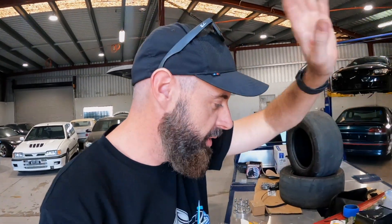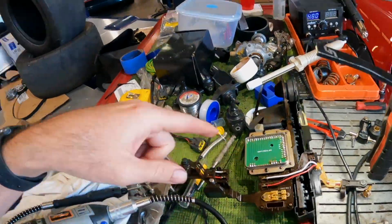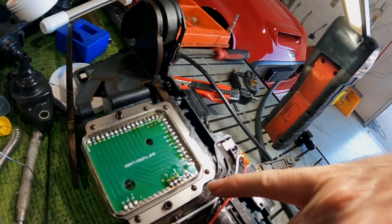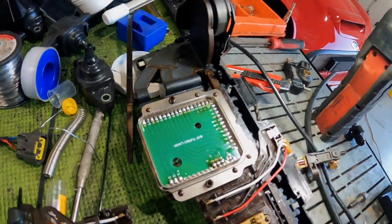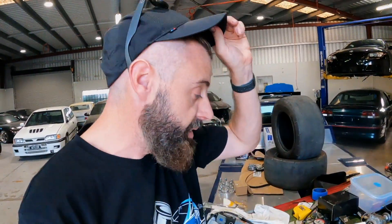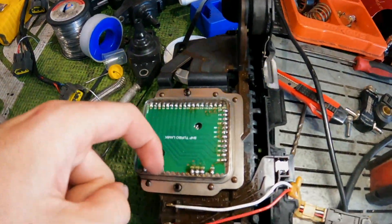I better get this PCB soldered and see if it fits. I've just soldered the PCB. If you watch my first Turbo Lamec install, I had a fair bit of trouble doing the PCB. The second one was much easier — I switched to lead solder and a better soldering iron, a gas soldering iron. I didn't have lead solder here, so I thought instead of ruining Dan's PCB I better go and buy some. I was still having trouble getting it to stick. Brock the engineer came over and showed me — he scratched up the soldering pads, and as soon as they were scuffed up the solder stuck to them really easily.